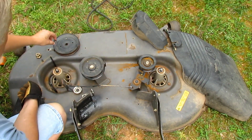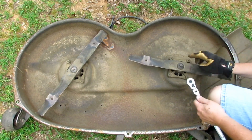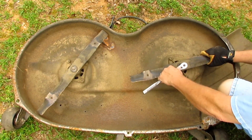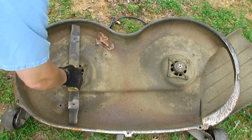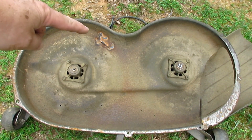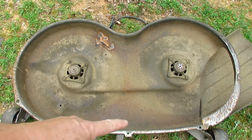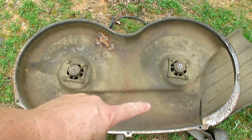Don't forget the spacer. Next thing you want to do is take the blades off — five-eighths socket or a wrench, and a glove on your hand so you don't get cut or pinched. This is also a good time to clean up under your deck if you want — scrape it out or whatever. Mine's fairly clean. You can see right up here where I've had to repair it because I broke one of the mounting ears off. I've done some welding in there. I'm also missing the baffle that goes right here because I bent it and didn't replace it — just a little sheet metal baffle.